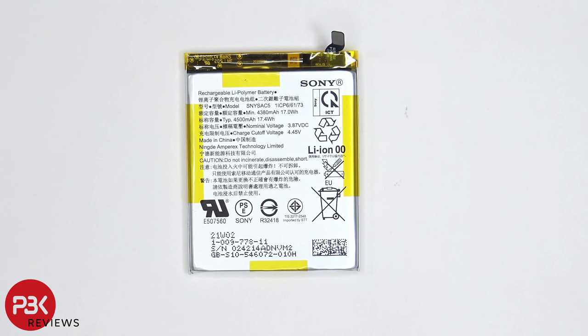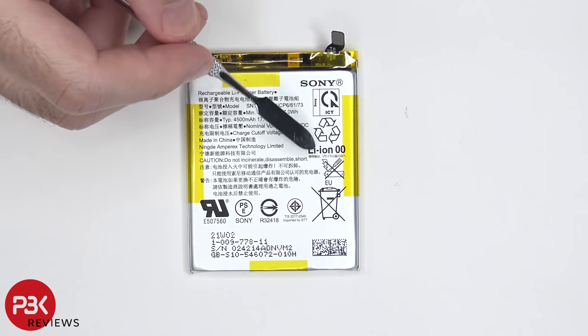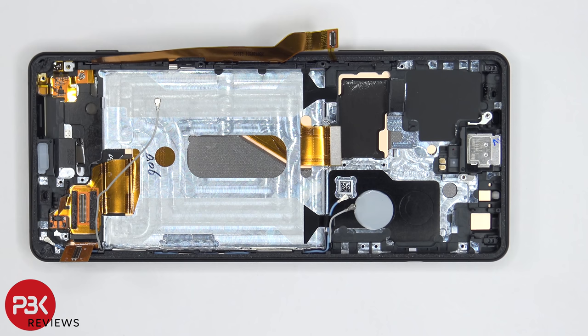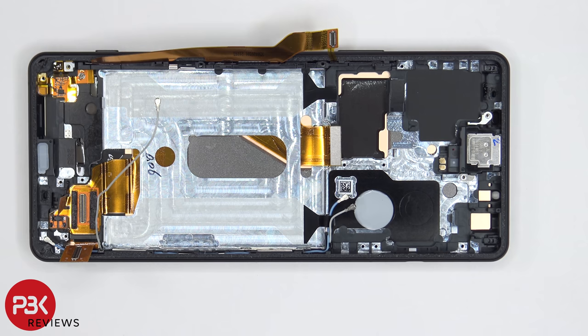Here's a better look at your battery. A lot of people ask if it's a lithium polymer battery — yes, it is. It says lithium polymer or LiPo over here. Some people get confused with the labeling which says lithium ion, but all batteries have that labeling on them. Once the battery has been removed, you can see those two pull tabs underneath. There's also a flex cable which is routed in between the mid frame and the screen, connecting your main board to the subboard, as well as the screen and the haptic feedback motor.